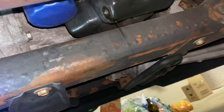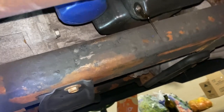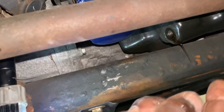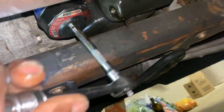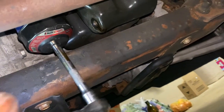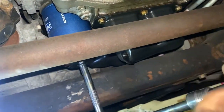You can see now we're starting to come down to a slight trickle, so I like to get as much oil out as possible. One may even argue it's better to jack it up from the other side so the oil flows towards the hole, but I'm going at it from this side — it's easy for me. Now I've put an extension on here to get better access to take the old filter off, so I'm just going to put it on there and start working it off.